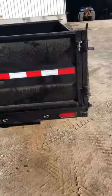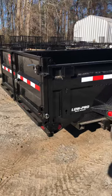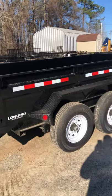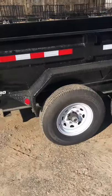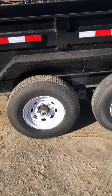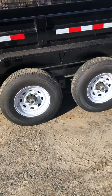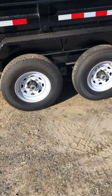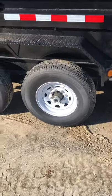You have LED lights throughout the entire trailer — taillights, marker lights, the whole nine yards. Everything's LED. This thing is sandblasted, acid-washed, and powder-coated, so the paint job is very, very good. They do offer an upgrade for a primer and powder coat if you'd like to go that route as well. You have heavy-duty ATP fenders on the side — they are non-removable, welded onto the trailer. You've got two 7,000-pound axles with brakes on all four wheels, which DOT requires in the state of Georgia. You've got 235-80R16 tire and wheel assemblies — they are radials, 8-lug, white-spoke. We do offer black wheels as well.